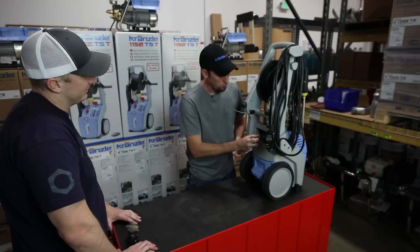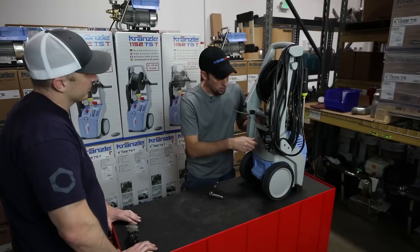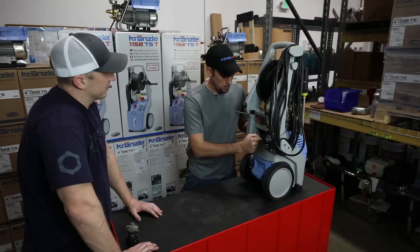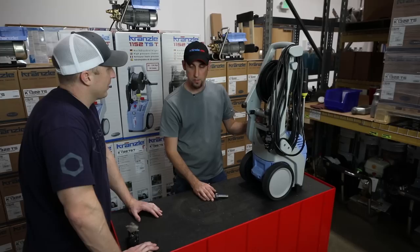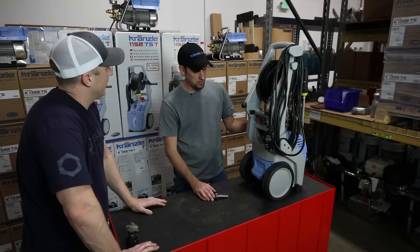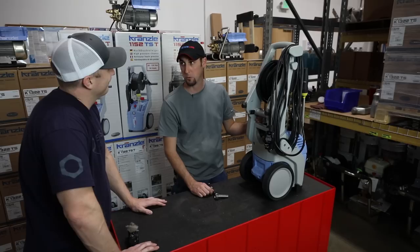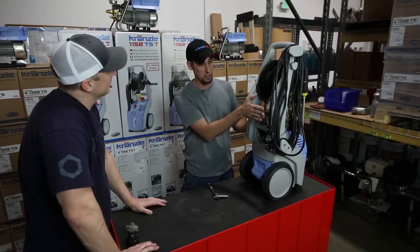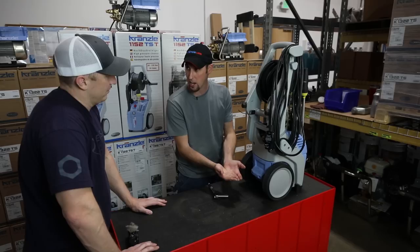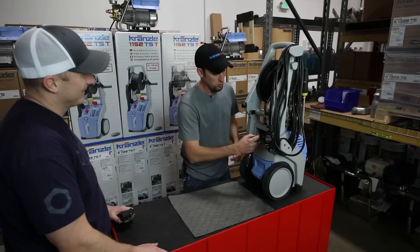It'll be pretty tight on the first removal. This has an O-ring — no crush washer. The O-ring can be reused as long as it's not marred or damaged. Hand-start it — don't use an electric impact or you'll strip it. The transmission housing is aluminum, so if you were to cross-thread it with the brass plug, they're both soft and you'd get cross-threading on both sides, which would be difficult to repair without replacing the housing. I find it helpful to prop up the wheels so you can get the plug positioned for draining.